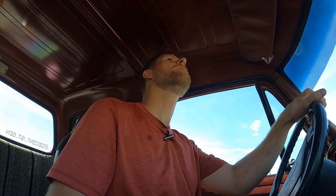We're going to do one more pull up the hill — I just want to make sure that white smoke and sputtering is gone. I think we're clear on that, but we have some AFC tuning to do now. When we tuned the AFC we weren't getting all the fuel, so we tuned it to fuel a little bit more, and now we've got quite a bit of black smoke. But that is what's fun about these trucks — I think it's really fun to problem solve and figure stuff out.